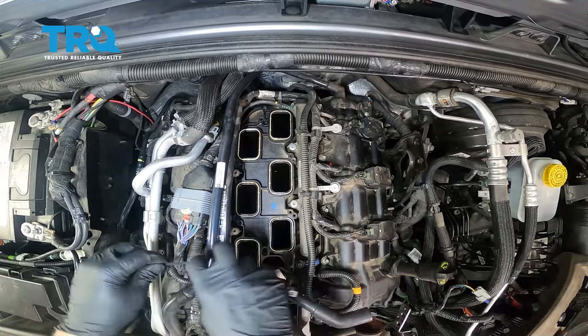Let's go ahead and try to lift this unit. See if we can get to that connector on the back side right here — pinch and pull that off. On that back hose, there's a hose clamp — grab a pair of pliers and pull that off. Use a pair of coolant hose clamp pliers to go ahead and remove this clamp, then work that hose clamp back. Once we get that back, we should be able to remove that hose. This will limit the amount of coolant coming out of the hose, though we're still going to lose some out of the cooler.